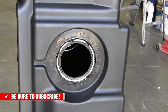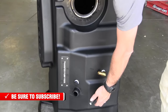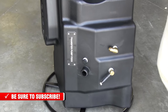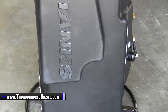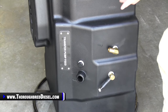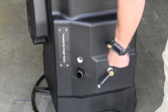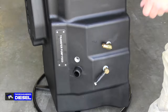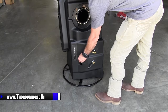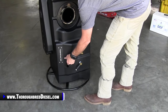Let's talk about the fill system. You've got your breather hose and your filler neck here on this tank, your tip-over vent, and your rollover vent. If you were to use an aftermarket lift pump and don't integrate the return back into the fuel basket, they've got a provision on this tank to put your return right here — it's plugged off currently. You can punch through it with a 5/16-inch drill bit and run your return flow right back in there. If you don't use it, they send plugs for it — you don't have to punch through it.